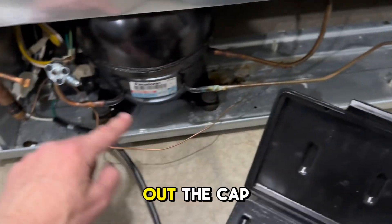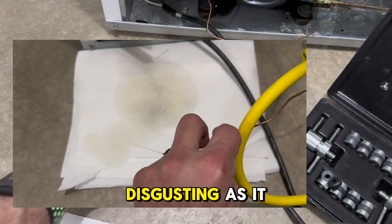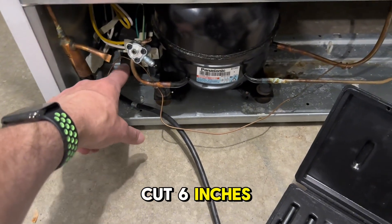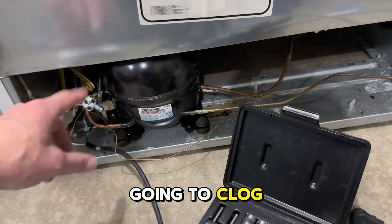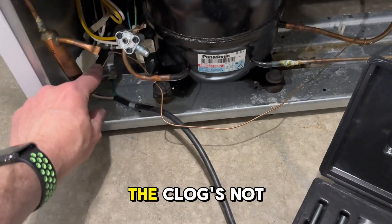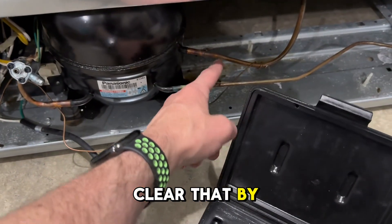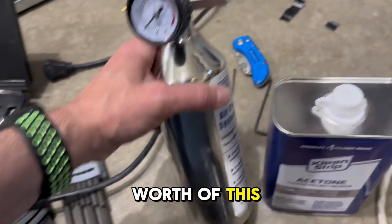When I've done this in the past I'll put a couple paper towels down here and it will just come out brown and disgusting as it cleans out that line, then it comes out clear and clean. If you think it's just the filter dryer, swap it out, cut six inches off, and you might be good for a couple of days — but eventually it's going to clog back up almost immediately. That's because the clog isn't at the filter dryer — normally it's on the inside right where the cap tube welds into the bigger tube.